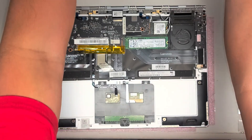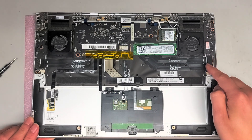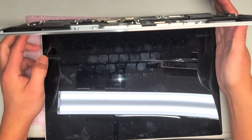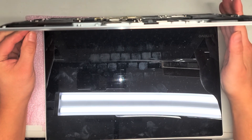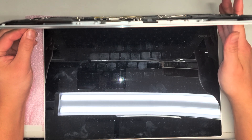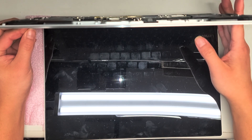Once you remove the battery, press and hold the power button to drain any remaining power — just so there's no risk of damaging any components. Do this for about 10 to 15 seconds; this will make it safer to work on powered components that have any stored power in them.